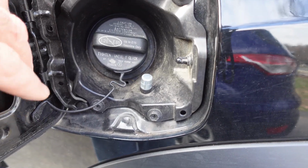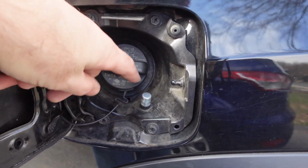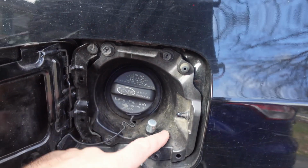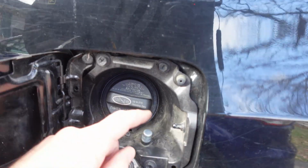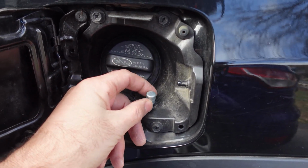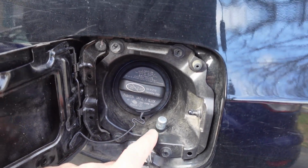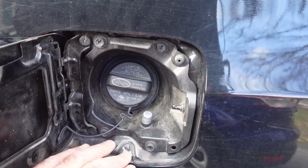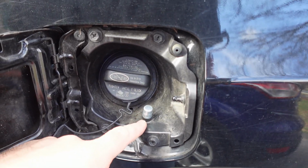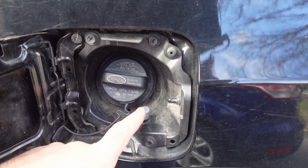What I ended up doing was I just drilled a hole in my plastic right here inside the gas tank area, and not the gas tank of course, but this little exposed area right here, and I just hooked your breather spinner up here. That way I have plenty of depth. I'm never going to go to the water this deep, never, or the truck will be dead. But this makes sure that the differential tube is not going to suck water into it from way up here.